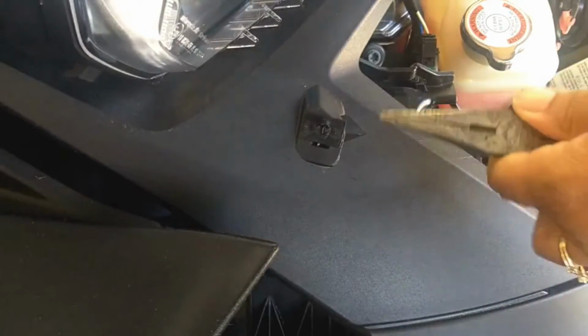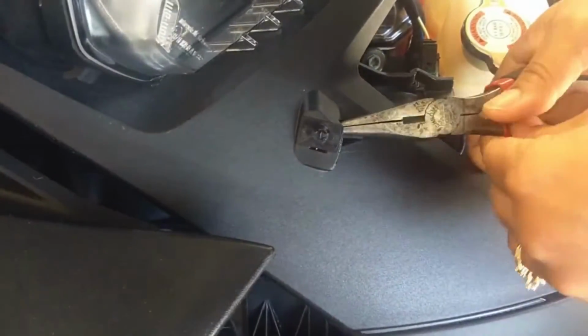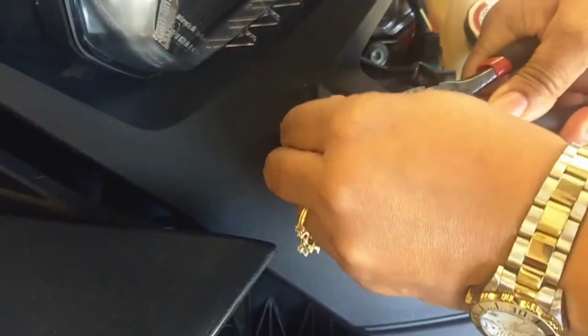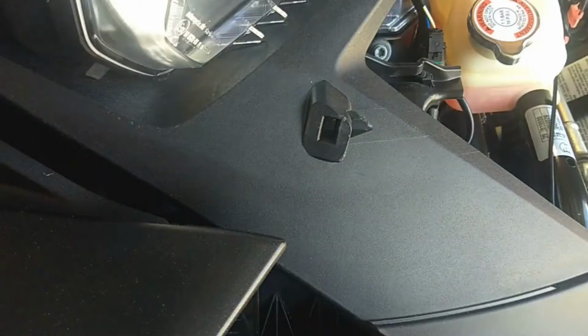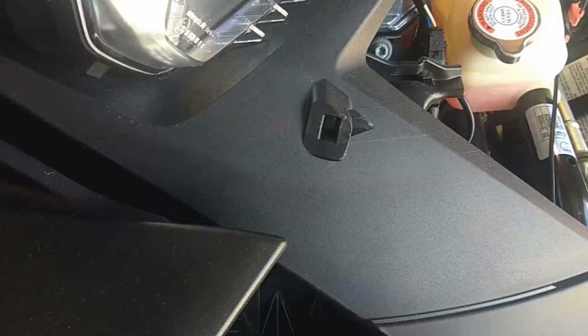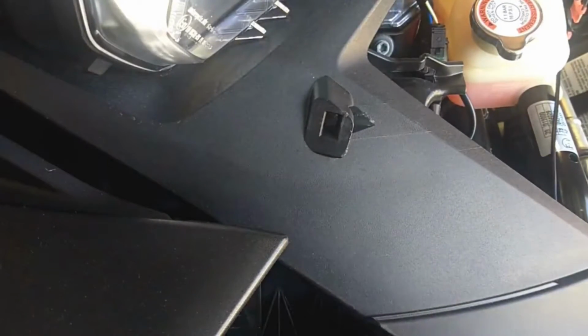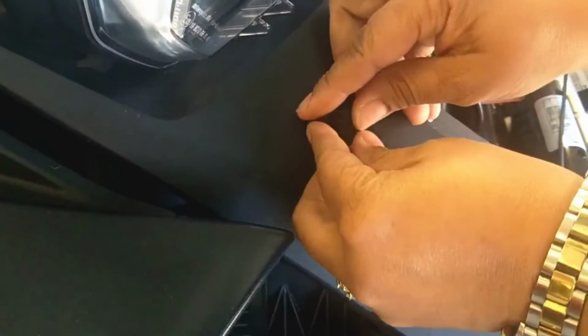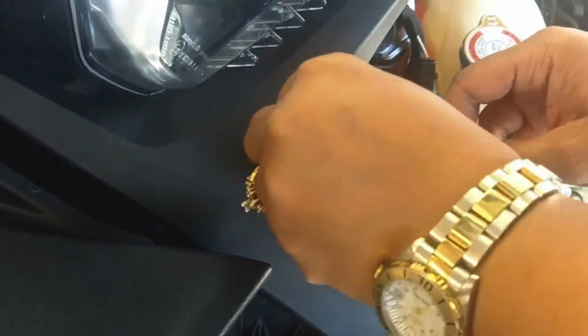I was going to try to force it under there, but if you look at the dart pin, you'll see it grabs on the underside, and I was concerned it wasn't going to work. So I tried some needle nose pliers to push under there. They were skinny enough to get under there, and I could push it up and then grab it from the top side. That was extremely easy to do it that way. Somebody recommended a little hacksaw to saw it off. That would work too, but I was concerned I would do more damage. The needle nose pliers worked like a charm.